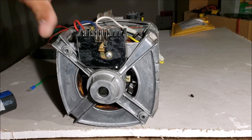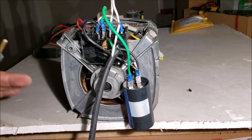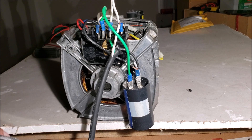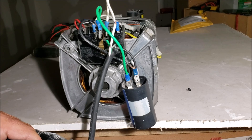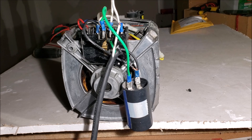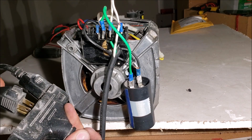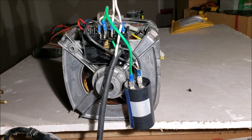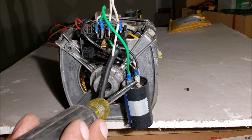The final test is the new motor — we're going to test it on the bench real quick to make sure it starts up on its own before putting it on the washing machine. When testing your new motor, give it power and then turn it off to make sure the centrifugal switch is working correctly. The centrifugal switch is working and the motor starts up instantly when we plug it in. Remember to discharge the capacitor every time you touch it.